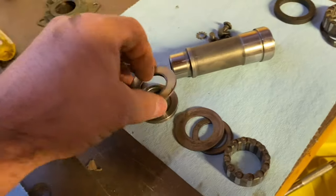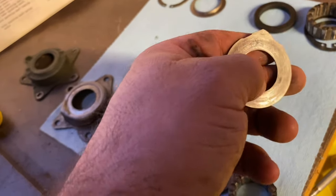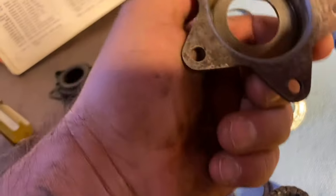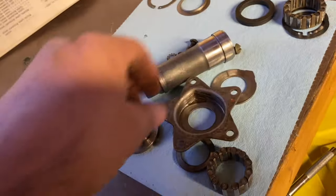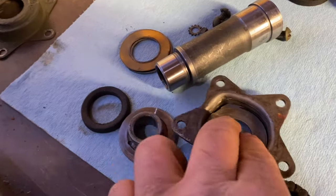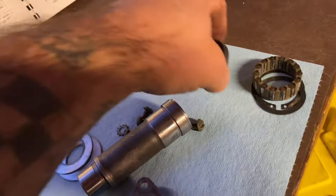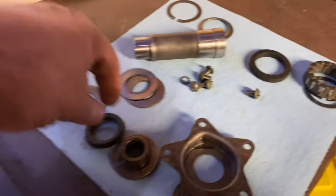There are so many different components here you have to look at. One of them is these spacers. You've got to look on the edges here and see if it's worn or not. This one's kind of ugly. There's a couple marks there. Look on the inside star piece. You're going to see marks right in there. These are made to go in here, but they're made not to move. If you can see how much that moves, that would need replacing, replace that, replace all your shims and your corks. Almost everything gets replaced at one point, once they wear out.